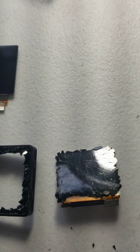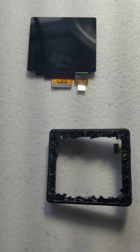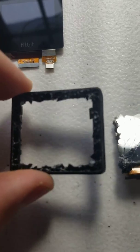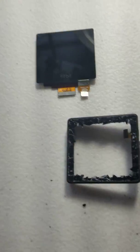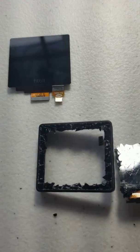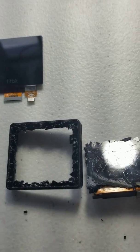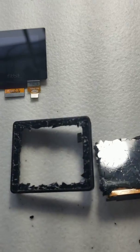So we pushed out, and in our case our glass is broken, so we've been left with kind of this ring of glass that's broken, and so we're going to have to clean that out and prepare this for our new screen to sit in, and we'll see what we got for options for adhesive after we clean this up. So we'll clean up that tray and get rid of this old broken LCD screen.